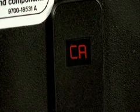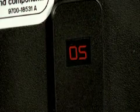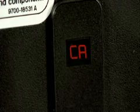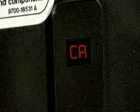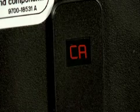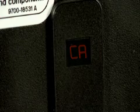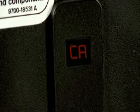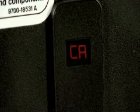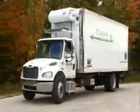There are also clutch abuse, or CA, and motor generator overspeed OS features with the system. A CA in the gear display indicates the HCM is detecting a clutch abuse situation, such as clutch slippage or clutch heat. If the vehicle detects a clutch abuse situation, it will first tone the push button shift control and flash CA in the gear display. If the clutch abuse situation continues, the hybrid system will only allow an electric launch, in addition to the tone and the CA.